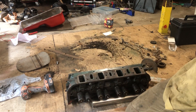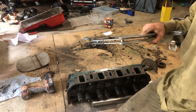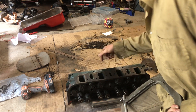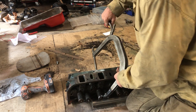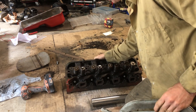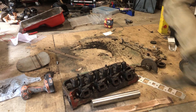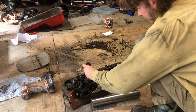Shop around online if you can find one — my grandfather left this to me. This is called a C-clamp valve spring compressor. I absolutely love these things because it makes removing the valve extremely easy. So we're going to go ahead and get the valve out of the way — open it up, put it on top of the valve like this and squeeze. Of course this thing's been on for 50 years so it might put up a fight, and if that happens we're going to get a hammer and knock this sucker loose because these things haven't been pulled in 50 years. So we're going to try to soften up that valve keeper — just grab a socket and a hammer and loosen this up, try to free it up a little bit.